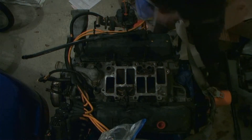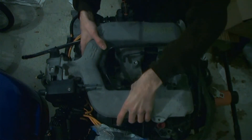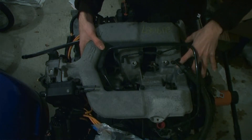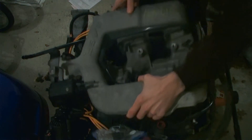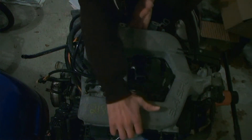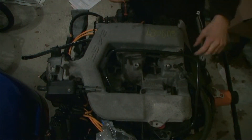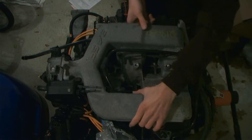The difference between the Fiero intake and the Camaro: one, the distributor cap would actually get in the way of the intake system, so it doesn't work. The other reason is the Fiero's intake actually points a different way. So there are two differences on why we don't use this intake — one is because of direction, and the other is because the distributor actually won't fit with this intake on it.